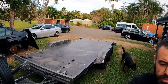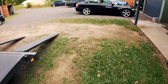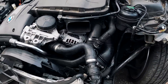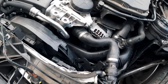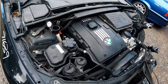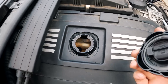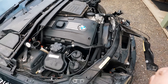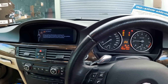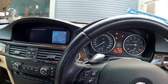It started and it moved. We haven't pumped any massive amounts of fluids out. Let's go have a quick look. Please everybody ignore the E36 M3 Evo — you did not see that yet, that's for another time. We've got no power steering but the transmission seemed to work. That is coolant dripping down. No immediate worries and I didn't hear anything strange while it was running. A little bit of N54 combustion smoke — that's normal. DSC failure, flat tyre failure — we've got a few errors, but that's sort of expected.